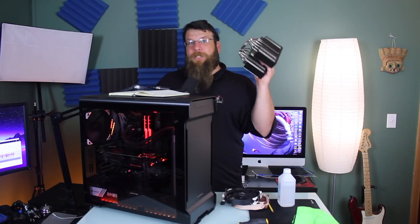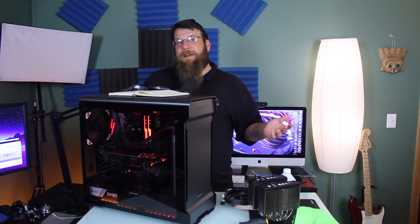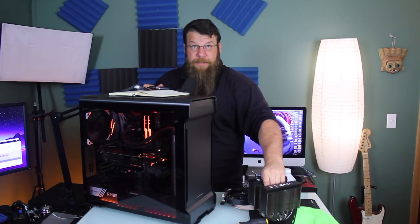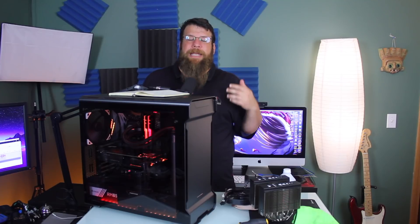It didn't matter if I was using one fan or two fans on the Noctua, and it didn't matter if I was using liquid cooling or air cooling. The simple fact is that the 8700K is a hot chip and it's very difficult to take that heat off. The way the 8700K is constructed, there's basically the chip, then a layer of thermal compound, then the IHS — the heat spreader — the silver part on top. Then you have to put more thermal compound on top of that, and then your cooler sits on top of that. Between the actual processor and the cooler, there are just too many layers. This could be resolved if Intel used better thermal compound or found a way to get the heat spreader closer to the chip, but they're just not doing that.